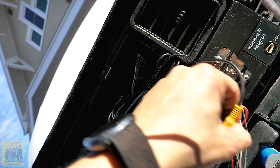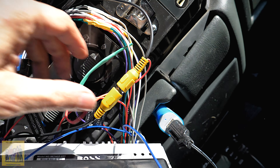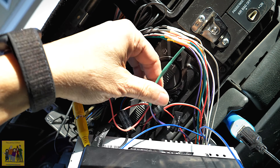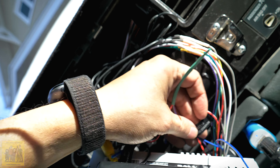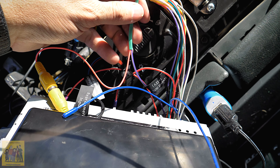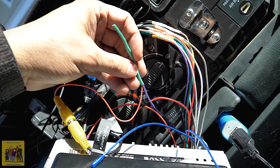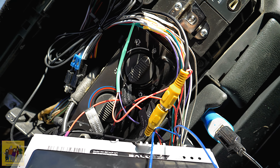I've got my cable ran. I bought 33 foot — that gave me enough to comfortably reach to the back and I've just tied it off here. Then you take the red wire off the cable and you run it to the reverse 12-volt positive — this purple and white wire right here. I've got it soldered onto there and I just put a long piece of shrink wrap on it. So I'm going to tuck this thing all back in now and show you the rest of how I ran the wire.